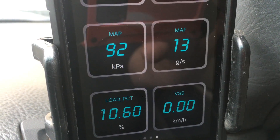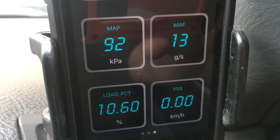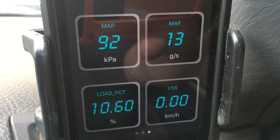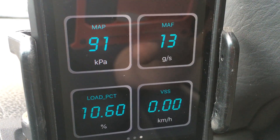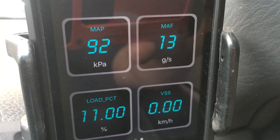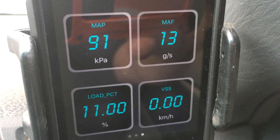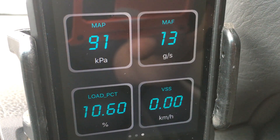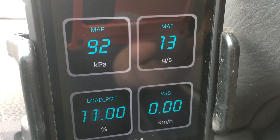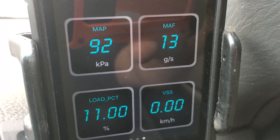The load percentage — on a 1KD and a 120 Prado, with the type of injectors all the 120s have got, and the most popular five-speed auto behind the 1KD in the 120, the readings you're going to get with good injectors is exactly what you're looking at here. These injectors are only about two and a half years old. So you're going to see readings — they're as good as new. If you look after things with the right maintenance, this is what you'll see. You might see 11 or 12, that's okay. Once you start to see on a 120 readings like 14 or 15, that's when you need to plug in another scan tool and investigate. You should probably do that once every year or two anyway.